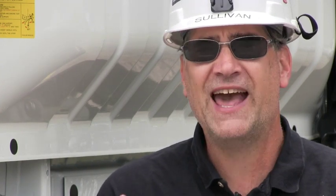The amp meter is a good tool, okay? It's a safe tool if used properly, and there's no reason for you to be afraid of it. Just don't hook it across the battery. If you hook it straight across the battery, you just blew your fuse, okay? So be very careful when you have it on the amp setting that you know exactly where you are and exactly what's going to happen.